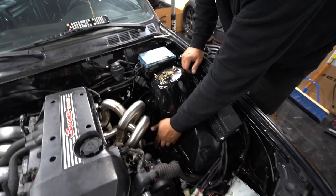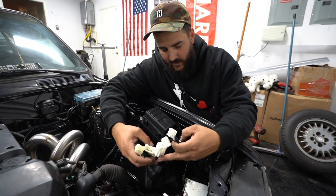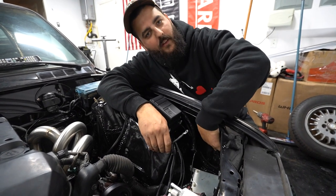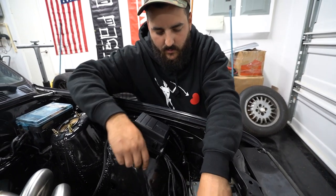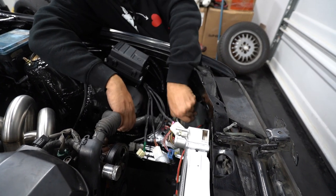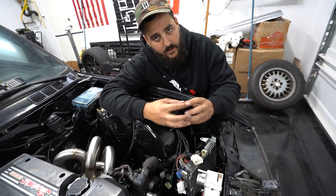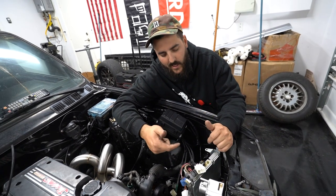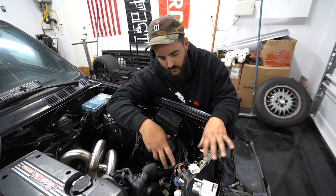This is the O2 sensor — it's just gonna hang out right there because it'll be headed down that direction. Most of these are self-explanatory. So this wire here is gonna be a ground. We're gonna throw this straight onto the factory ground that's right here in the fender well — there's already some ground wires coming to it. As far as the ECU is concerned, you're gonna have a couple of wires coming off of this that you're gonna use and a couple that aren't. Some of you guys are gonna have a box for your beams, and the box is gonna have a bunch of extra plugs and even one that marries them. I had to order one because my motor didn't come with one. AK had one laying around so they were able to send me one, but it's not gonna be here for a couple of days, so we'll get as far as we can for now.